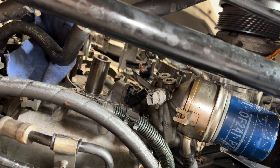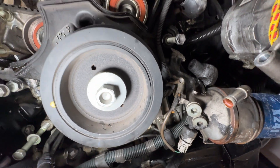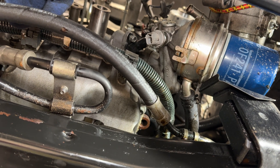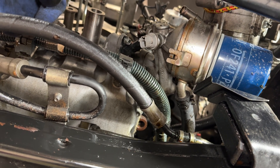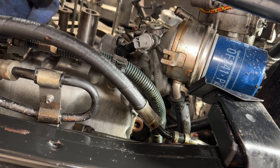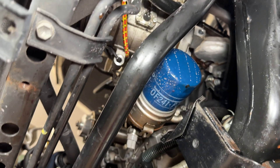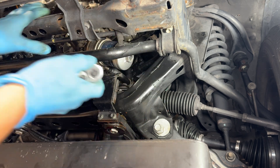I've got the top coolant hose already disconnected because I'm doing the water pump job, but if you didn't have that disconnected you could kind of do it without even removing those hoses if you do it under the car without taking everything off. On today's video we're gonna go ahead and just take everything off to make it easier. The first thing we want to do is remove the filter — you're gonna end up losing a lot of oil out of here.